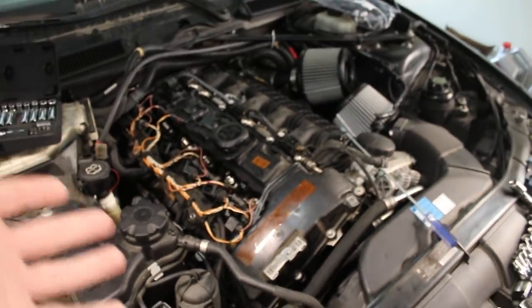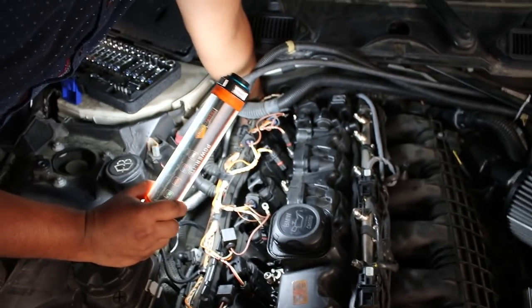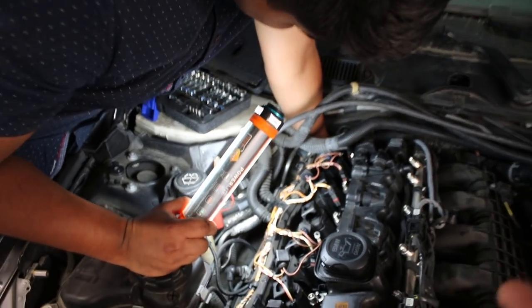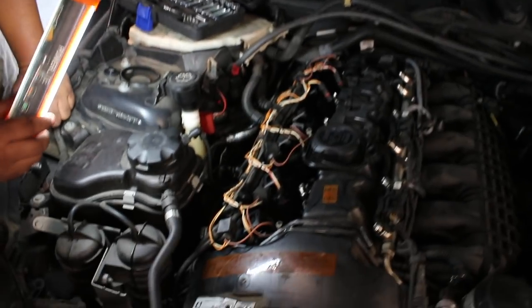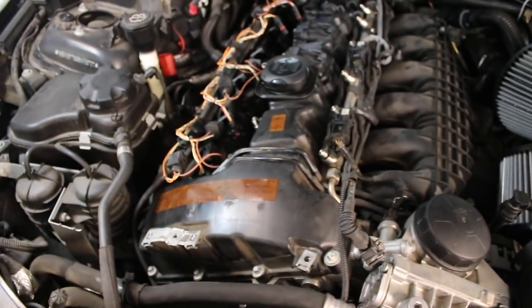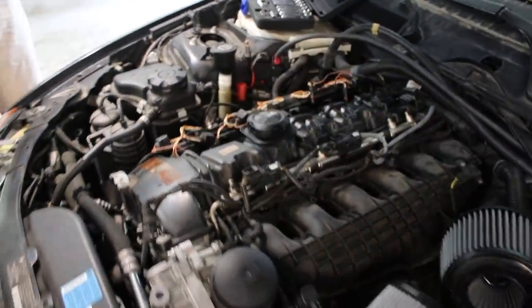We're gonna be installing the steering wheel on this bad boy, but you guys know we got to focus on the priority and fix this valve cover. Erlon just put his hand down there from the back — and I told you guys most of the oil is coming from the back. You guys were telling me it was most likely the turbos having some serious issue, but he's feeling a lot of oil from the back of the valve cover, and that's new oil. It's a lot of oil dropping onto your cats and your turbos, and that's causing it to smoke. I'm probably gonna end up doing a whole new oil change — better safe than sorry. We're pretty sure the valve cover needs to be replaced, and hopefully that should stop the smoking, because I gotta get this thing through smog.